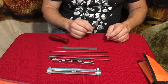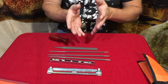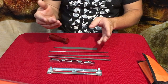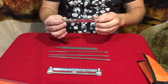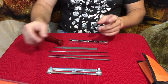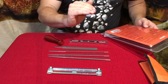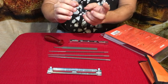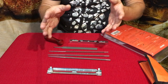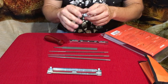Some chains even have a guide line on the teeth themselves showing the angle to use. Now, for the flattening file — you've got the part of the chain that cuts, which is the piece bent at an angle with the cutting edge, and then there's a little hook piece in front of it. That hook piece basically clears the shavings out — that's primarily what it does.